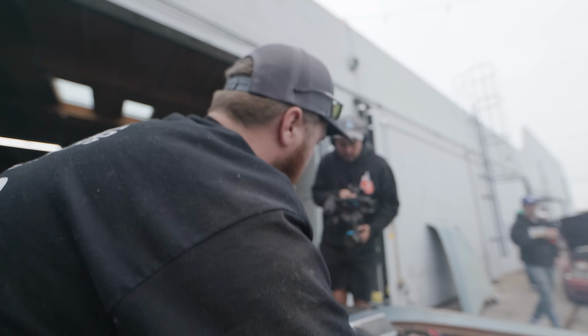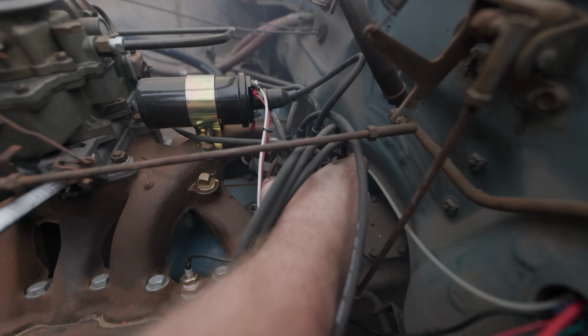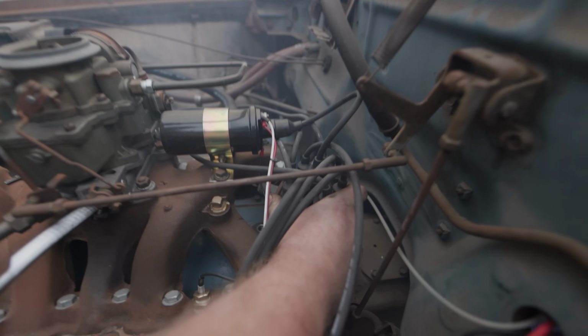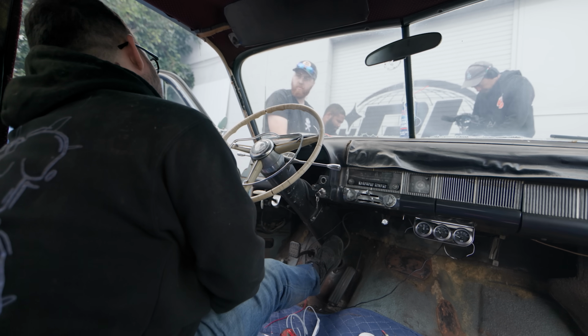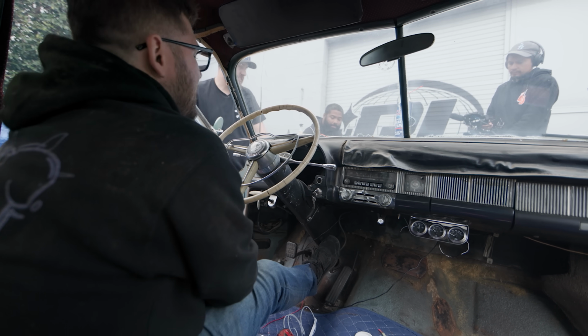Here's a good example of why ignition timing matters. Listen to the engine. Revving up and down, but I am not moving the throttle. That's actually how you set your idle. You can see more of that on my channel. It gets really in-depth. Kevin, I'm not seeing the temp gauge rise at all. It won't until your thermostat opens.